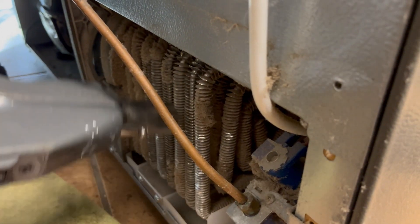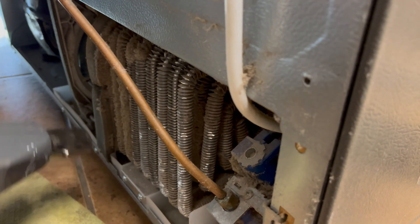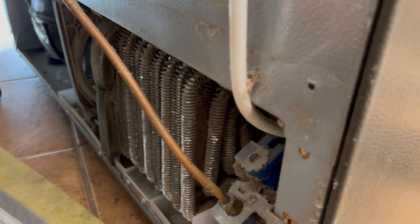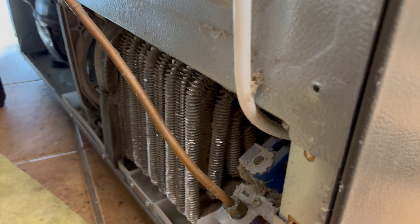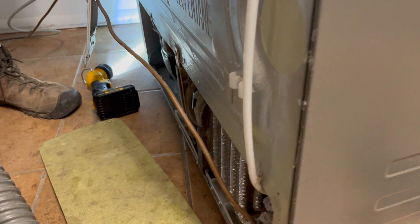That's what took place there. You can see the dirt on the coils. It seems to me the last time we pulled the fridge out and cleaned the coils, the freezer drawer wasn't getting cold air. I had it packed completely full, and I don't know whether I was blocking some vents at that time — I probably was. I'd recommend not having it more than three-fourths full maximum.